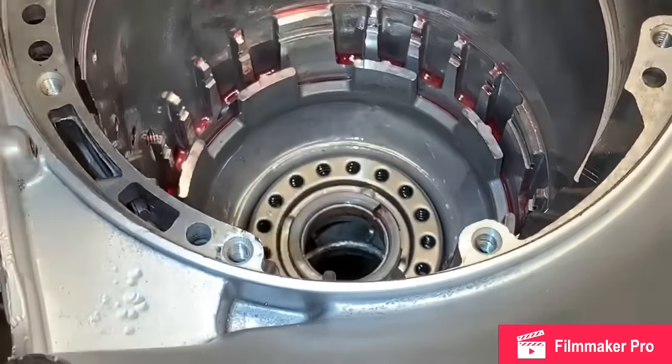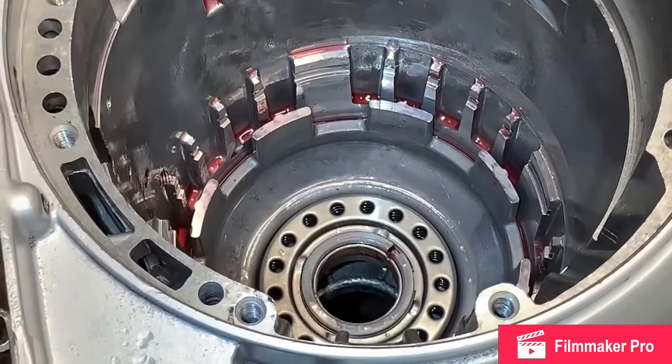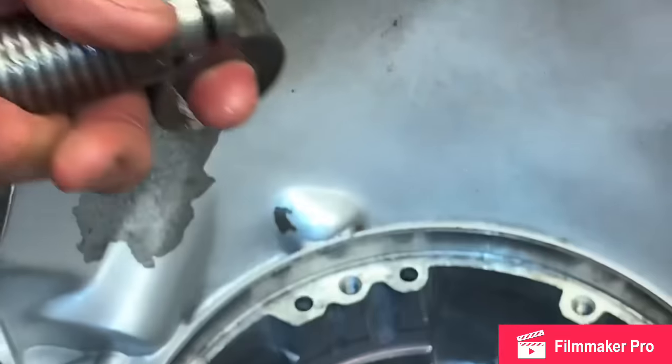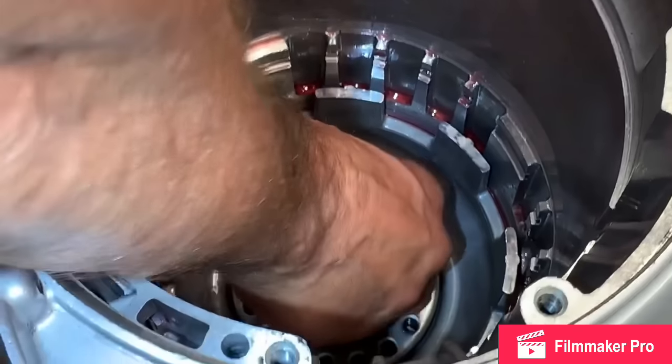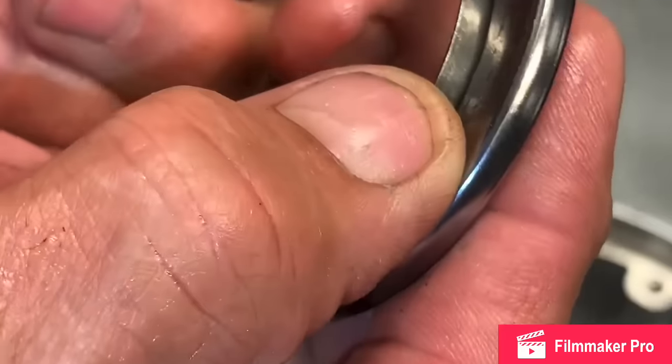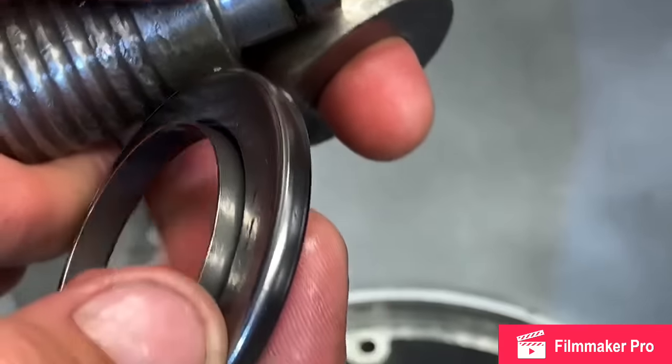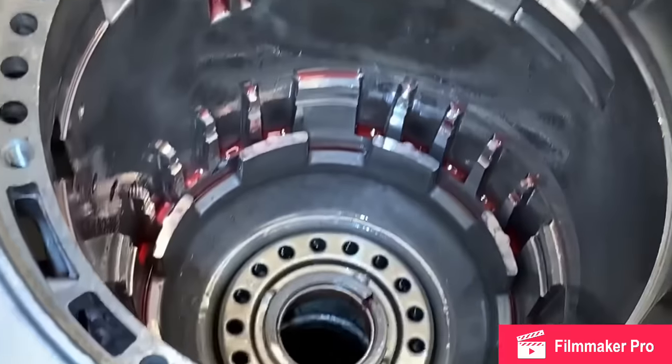That way the bushing is straight. Now, what I mean by depth is, the bearing that sits on there has a chamfer on it right here. You have to put that bearing lower than that chamfer. If you don't, you're fixing to make a lot of metal and mess up a lot of stuff. So let me show you another little thing.